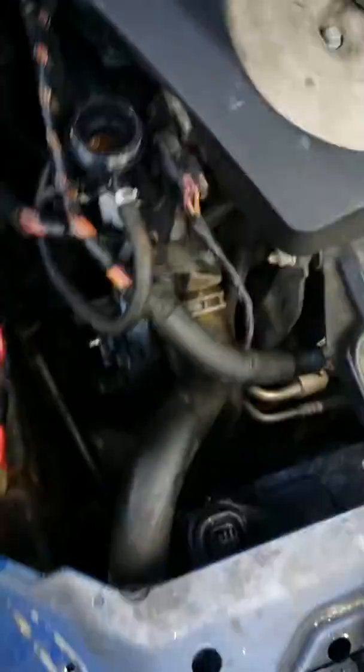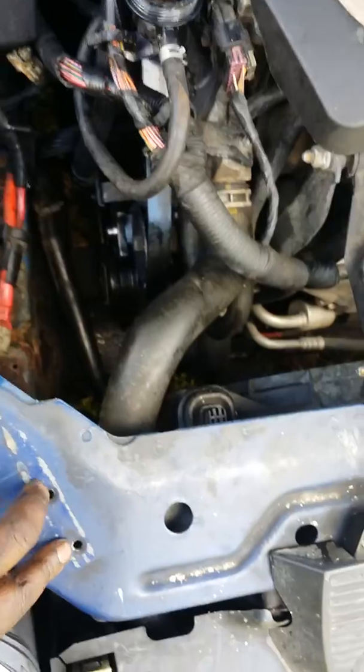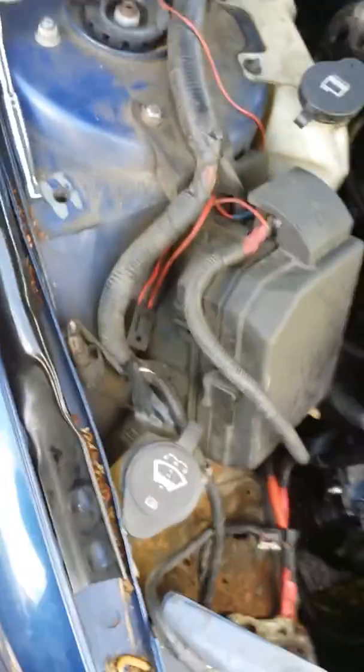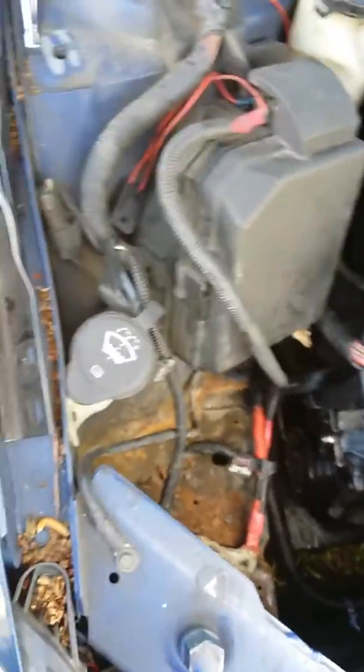As you can see I disconnected the battery, but the first step is that bar that comes from here to here — it's 13 millimeter bolts. Took those two out and that one up there. This is the bar that came out. Next I disconnected the battery, and if you take the battery tray out — the hose, the battery — once you get the battery out, these batteries are a beast. I just tilt them upside down on the inside and pull straight out.